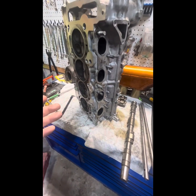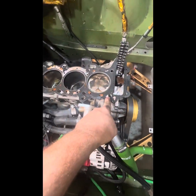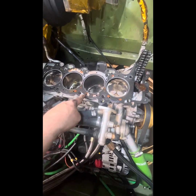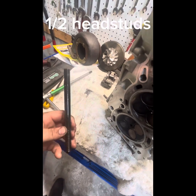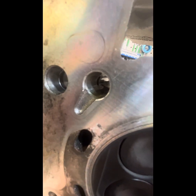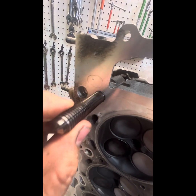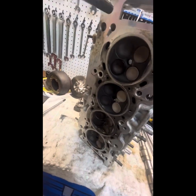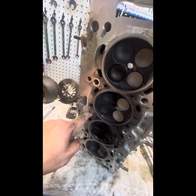I have an oiling problem to the head. After talking to Maz Works and doing some research, I realized — if you walk over here — this is oil pressure to the head, and it goes through this little galley right here, then up through the head stud. Well, I have upgraded head studs. There's an oil galley right there — you see the hole that feeds your head. With the upgraded head stud, you see how tight it fits? It's too tight. There's not enough oil getting around it to go up to the head. So this one and that one are far too tight. I've got to expand these holes to about 17/32nds to give it a little extra space so the oil pressure can go around the stud and up to my head.